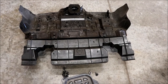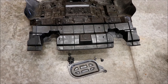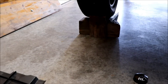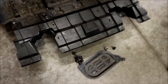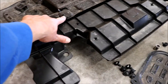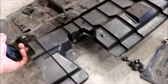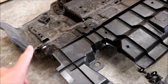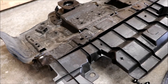One of the first things you'll have to do is remove all the panels underneath. It's really hard to film because it's difficult to get underneath. I do have the truck up on ramps — otherwise there's just not enough clearance to get to where the oil plug is, which is way in the back. I started by taking off this plastic piece first since I wasn't sure what was holding it up. They have hooks in the front, so you have to bring it down and slide it. This panel, although very flimsy, is extremely heavy, so if you're not sure, leave a bolt in the back of it.